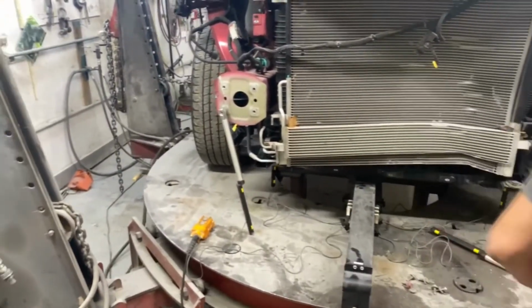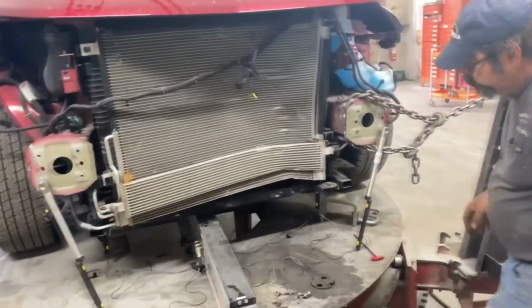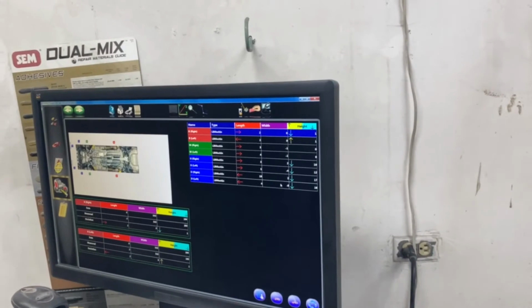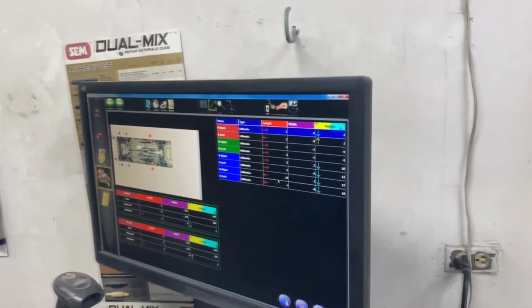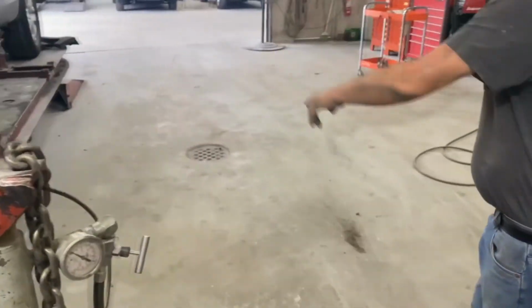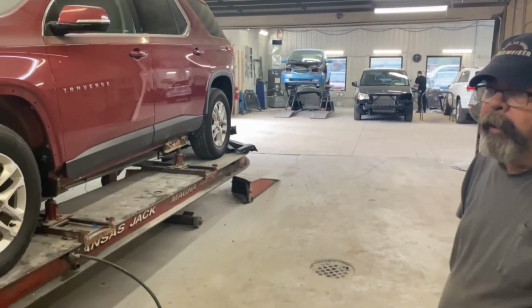Hold it off the stand. Happens. Still 8 wide on the left. That rail's getting replaced. 19, the diamond's there, and that's going to magnify as it goes forward. Next, hold it right off the stand. So at this point, I'm going to shut you off, and we're going to reclamp it and go again.